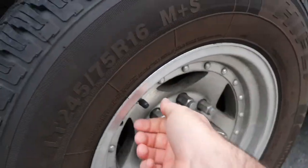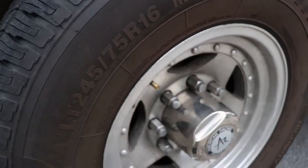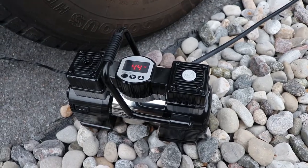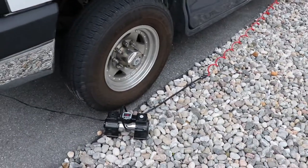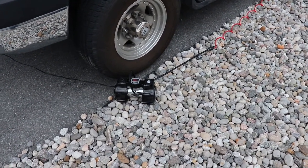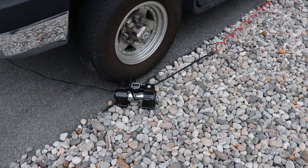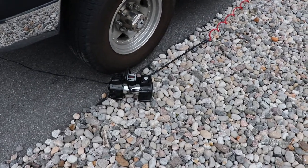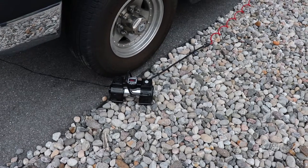So I'm going to get this one ready. We'll do a front one as well because it's at like 50. This vehicle's got eight lugs and 140 foot-pounds of torque, so it's kind of nice to have an air compressor with you rather than having to put on your spare tire. With this you can pump up your spare tire before you mount it because it's probably going to be low.